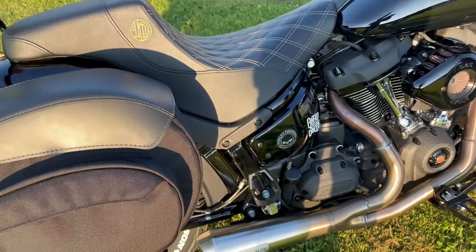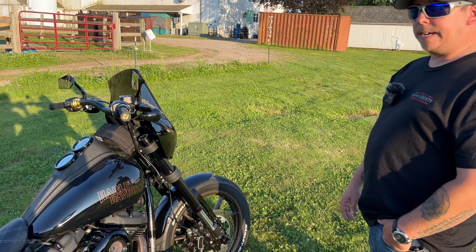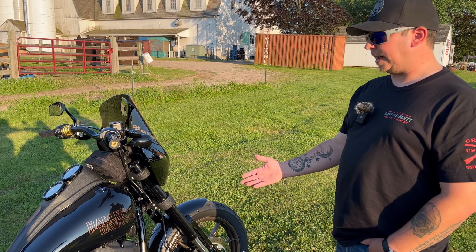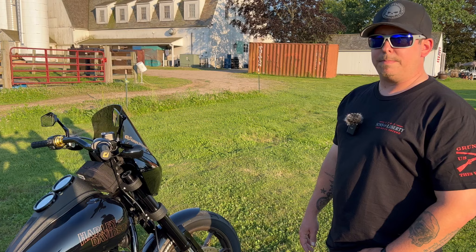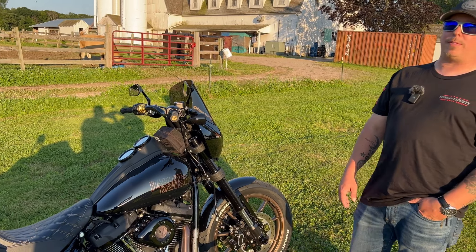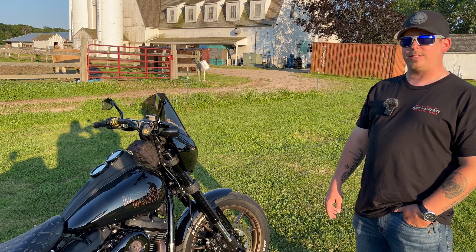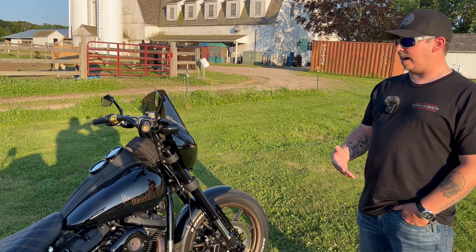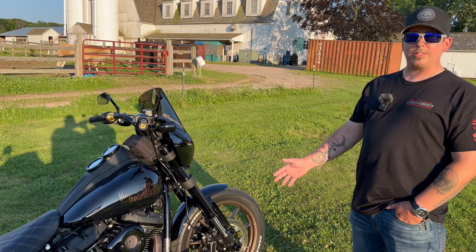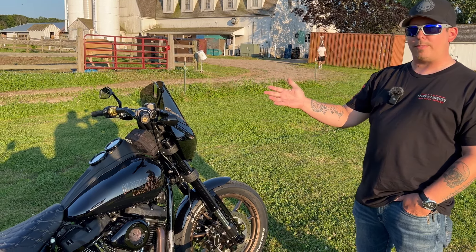I'm running a Harley Screaming Eagle Street Pro tuner right now, but I intend on very soon doing a full cam chest setup — I'm going to run a Power Vision. In order to get real power out of these M8 motors you really need to do something beyond a Harley cam. I'm actually thinking of doing Wood Performance — they have a new cam, the WM8 22X, and they also do a 22XD they call their hooligan cam. It's the highest lift, most aggressive lobe you can get using a stock valve train. Paired with a Power Vision tuner, we're looking to get somewhere between 125–130 horsepower and about 140 foot-pounds of torque. She's sitting at about 95 wheel horsepower right now, so that should wake her up quite a bit.